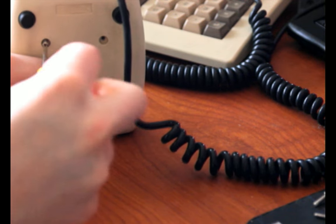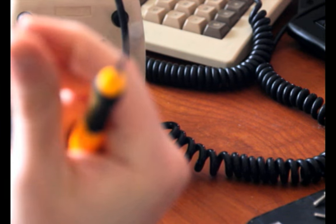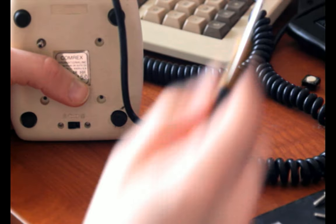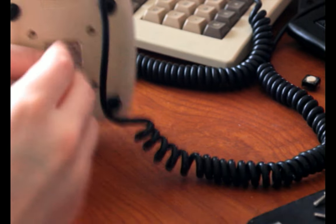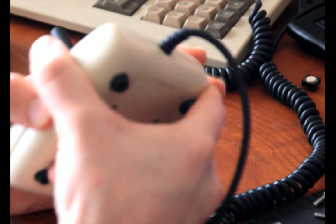Oh, and I'll tell you what that variant is, actually, that's a good idea. It's the Omron B3F series. And I think the one I ended up going for was the B3F5001, which is a gold-plated contact switch, so it's supposed to be more reliable, and we'll see if that means it lasts longer and doesn't oxidize as much.